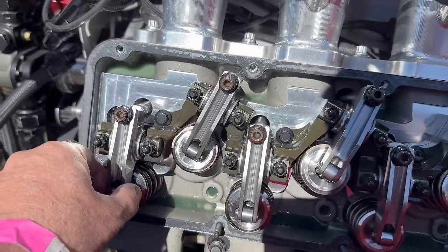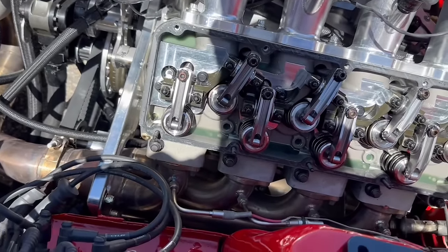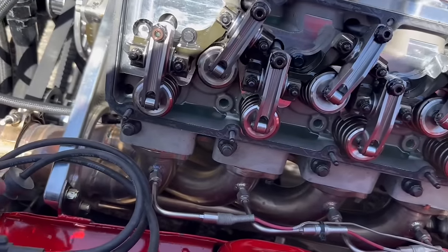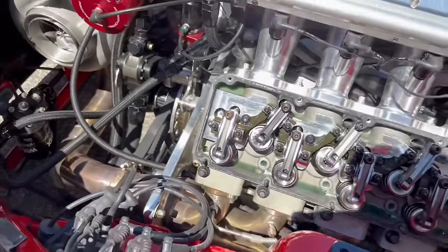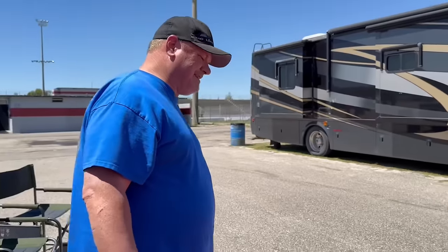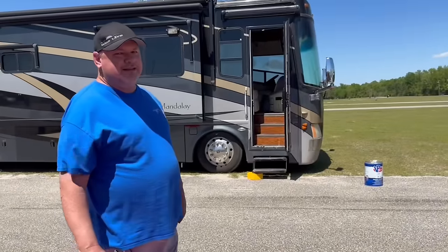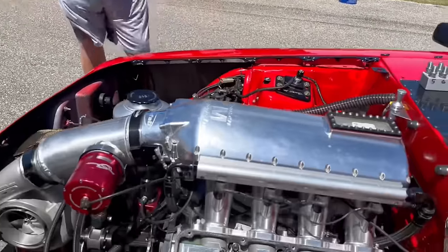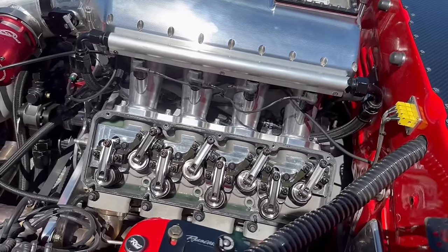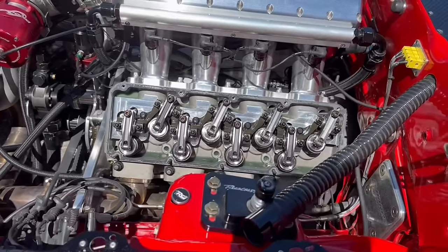So most likely what happened, hopefully all it was, is the spark plug wire was a little loose on the spark plug. It was 1:30 in the morning. That's true. We didn't check it this morning. We did, it was late last night. So I guess we should have checked that today. If we ever do that again, I'll check them. But so it just lost it. So it probably vibrated loose. It probably just didn't get all the way on there.